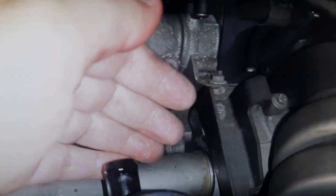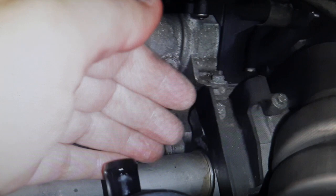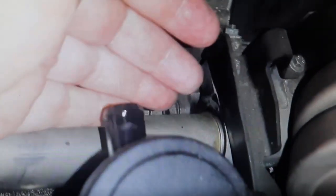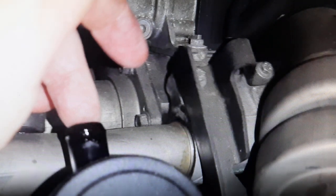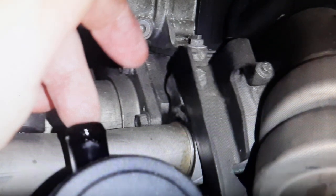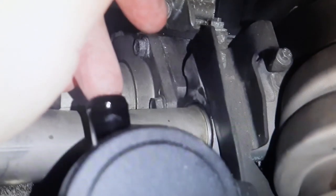There is oil that is liquefied. This is a very simple way to check if the PCV valve works well — that it is not clogged because it is letting oil vapors escape, or that it has an internal problem where, in addition to oil vapors escaping, engine oil also escapes.